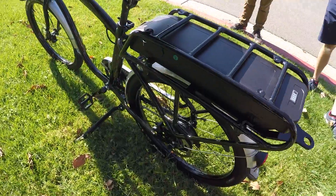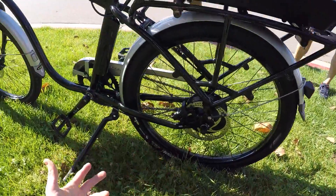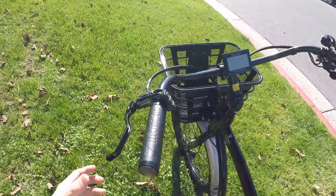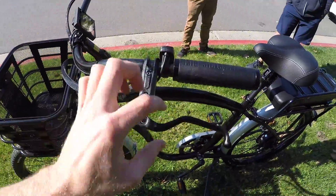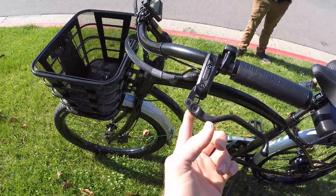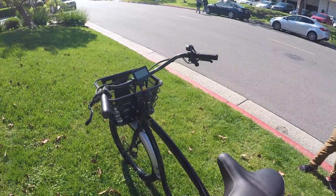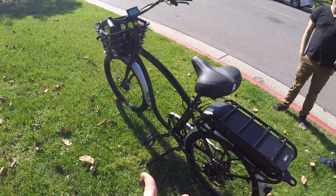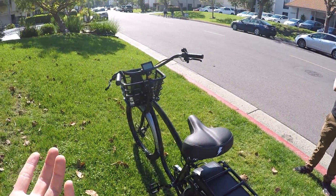When you're dealing with a bike that is heavier and higher speed, you need good brakes. These are 180 millimeter hydraulic disc brakes from Bengal — a brand that's a little new to me, but these are e-bike specific brake levers with motor inhibitors. They're slightly oversized with a little nub at the end so your fingers don't slide off even with gloves. Adjustable reach on these — all the stuff you'd expect from hydraulic disc brakes. So many e-bikes just have mechanical disc brakes and say 'good enough,' but if you can have hydraulic, of course you want that.